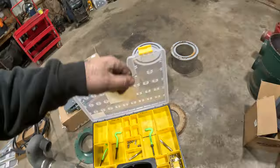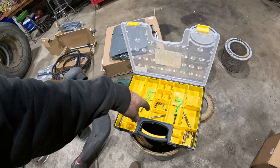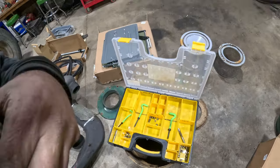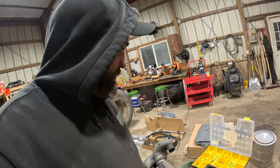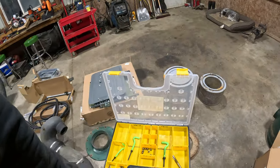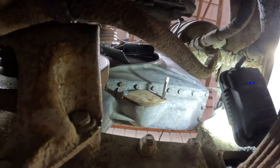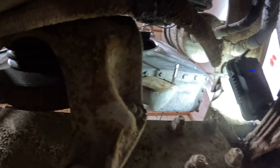And I had this kicking around underneath the bench here for a while. And slowly getting organized. So we need 5/16 by 18. So you go in, tap your hole to that size, and then thread that in, and your other one threads into that. Simple as that for when you strip out stuff. So I should be able to tap it and actually insert the coil without having to take that cover off. That is kind of my thinking because we already did seal it.